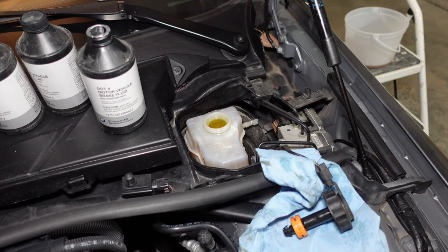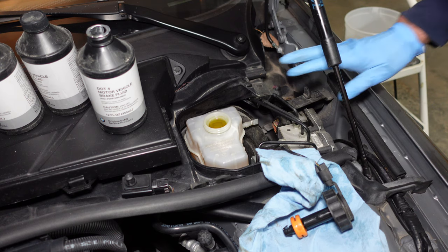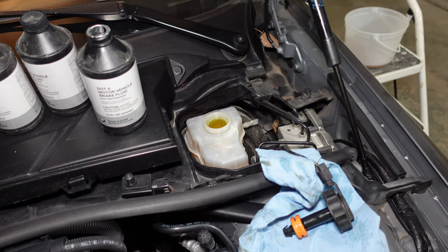You don't want this running dry while you're bleeding, so we'll have to come back and keep topping this up. Any air getting sucked into the system means a much bigger bleeding process to get that air back out, so it's very important we never suck any air into the brake lines. We're ready to move on to our first wheel. We'll start at the wheel furthest from our brake booster, which will be our rear right tire. You always start with the furthest tire and then work closer — so we'll do the right rear, then left rear, then front right, and lastly front left.